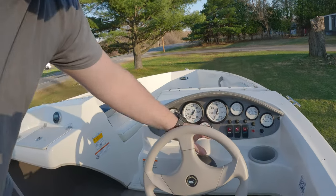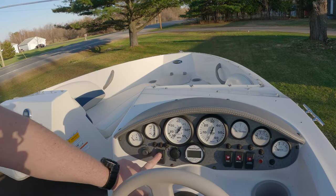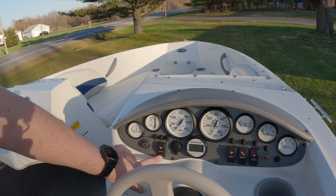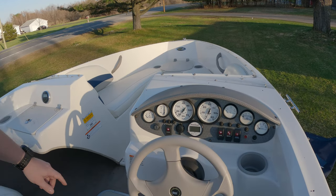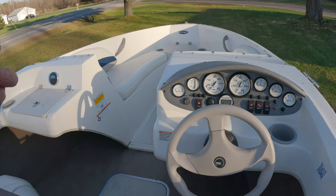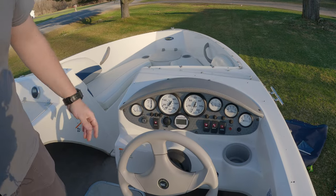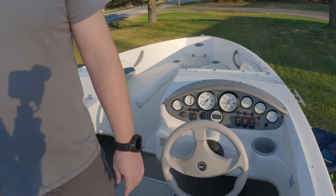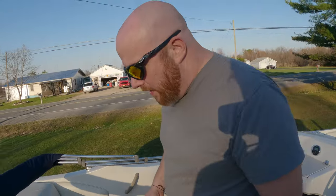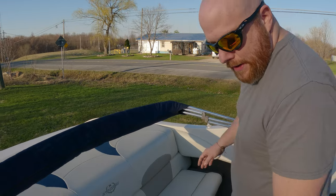One of the big things you're going to want to do is when you first get in the boat, it's suggested that you turn the blower on. Just rock that switch, turn it on for about three to four minutes before you start the engine — it actually tells you right here. Once you hook up the battery and all that, you just put in the key and go. It is still winterized. Captain's chair there, captain's chair there.